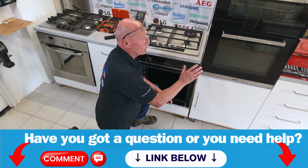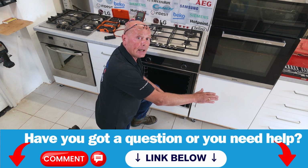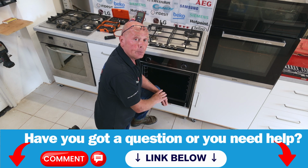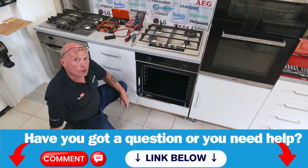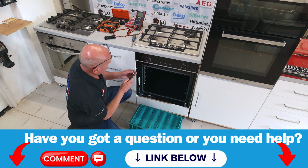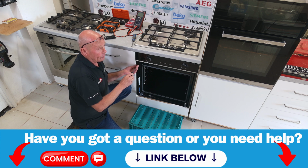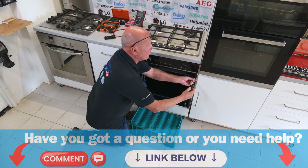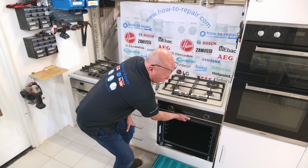Now we're ready to take the cooker out, but on double ovens you will need a table, and I suggest putting a towel on top of it, and you may need two people to lift the cooker to get it out. With a single oven, I'll just use a small crate. Putting this down, we are then able to remove the two screws that hold the cooker to the chassis of the cabinet. On double ovens, there may be up to 6 screws. Now that you've removed all the screws, we're ready to lift the cooker out.